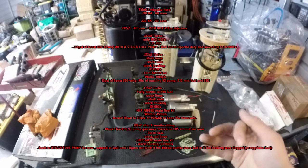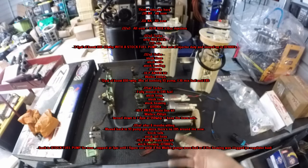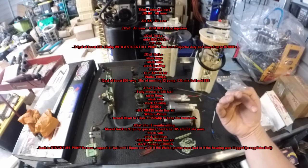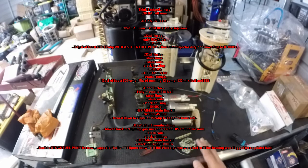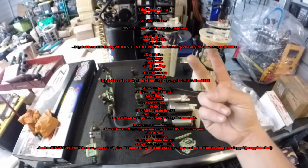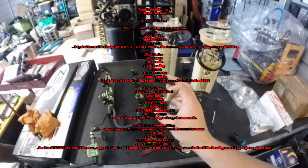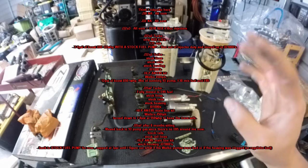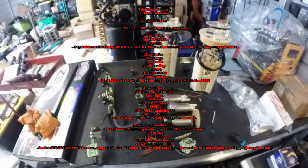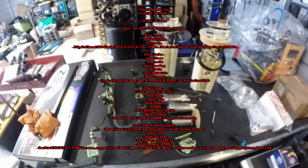Moral of the story: unless the duty cycle calls for more — rule of thumb is 90% duty — you should look into upgrading. Unless you're going past 350 to 400 wheel horsepower, you don't need to do anything to your fuel system. The J32 turbo on E35, everything was stock except the OEM RDX 410 injectors, pushing about three and a half to four pounds of boost for roughly 400 wheel horsepower. If you get RDX 410 injectors on an E35 mix, it will be good for roughly 350-400 wheel horsepower.